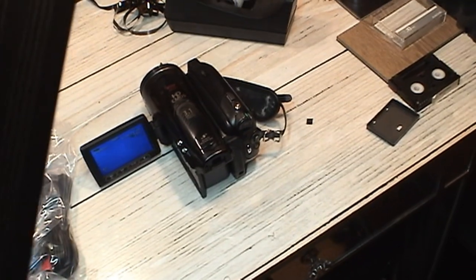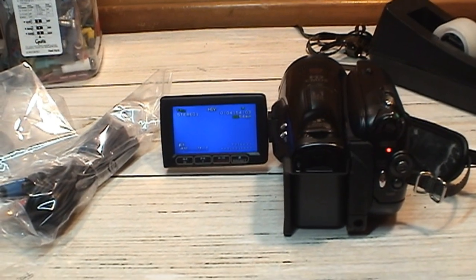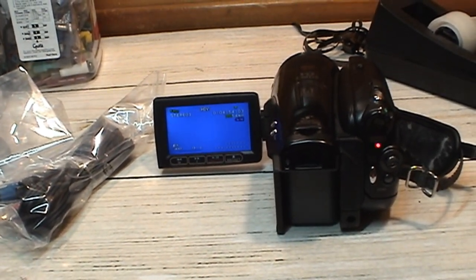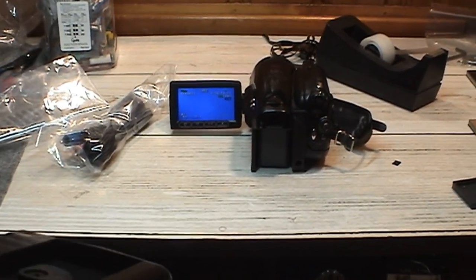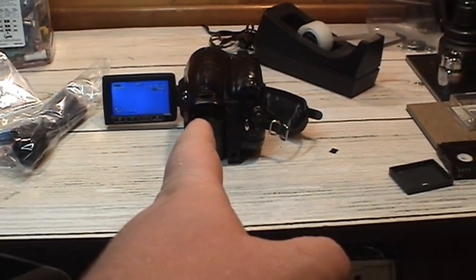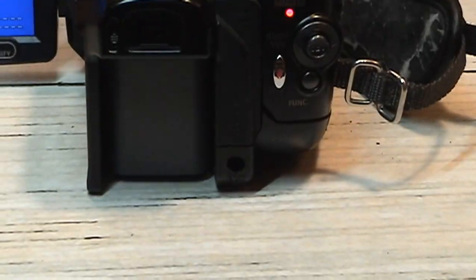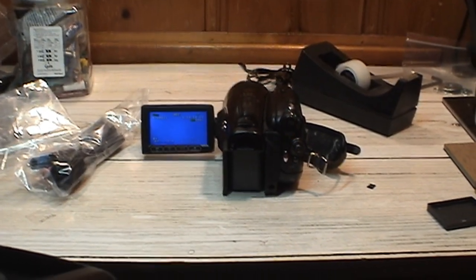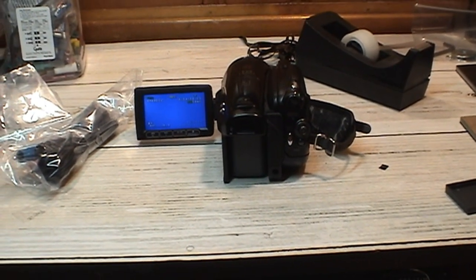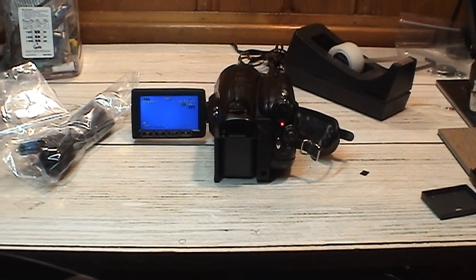I almost am wondering if perhaps it was the tape that was causing the problems when I first brought power to this thing, and it said reinsert cassette and started blinking and beeping. I'm almost wondering if maybe that's what happened, or perhaps that tape got screwed up when this thing probably was on a tripod and somebody walked by and dragged it down and it fell, breaking the little DC power jack off inside the camera and maybe screwing up the tape and possibly misaligning the tape mechanism. And perhaps my giving it a couple of firm whacks on its underside is all that was necessary to get it back up in ship shape.